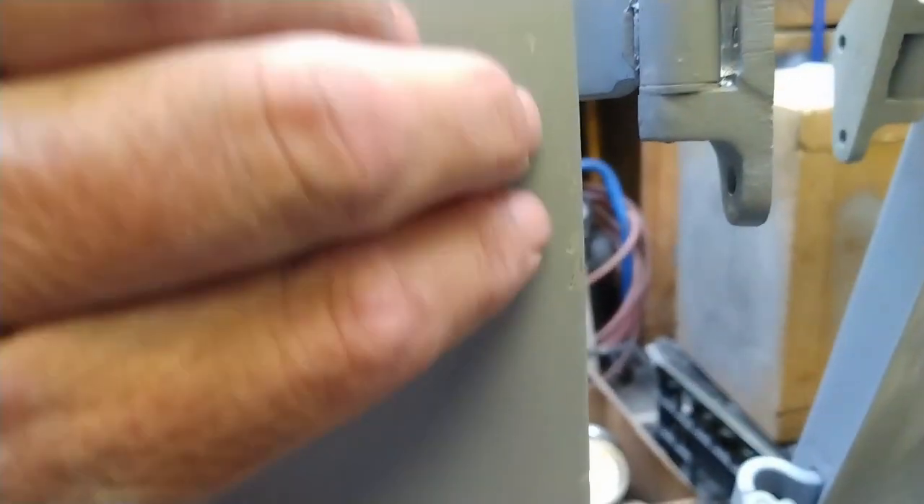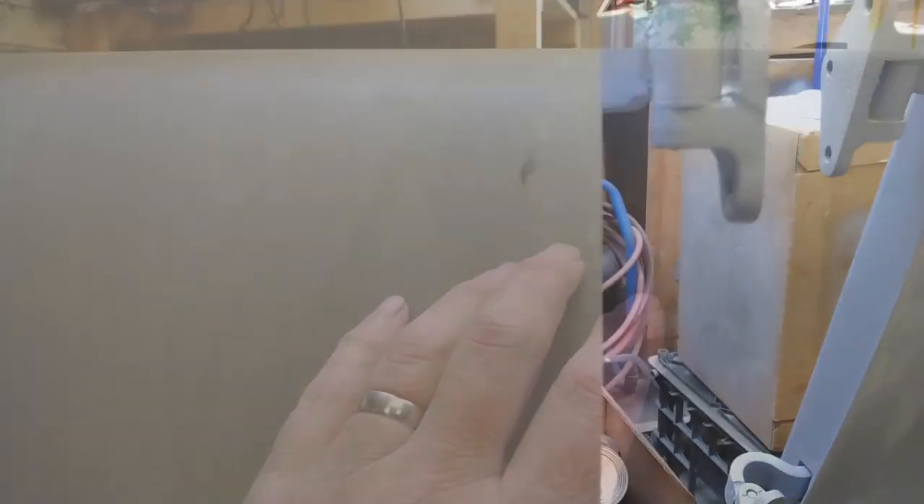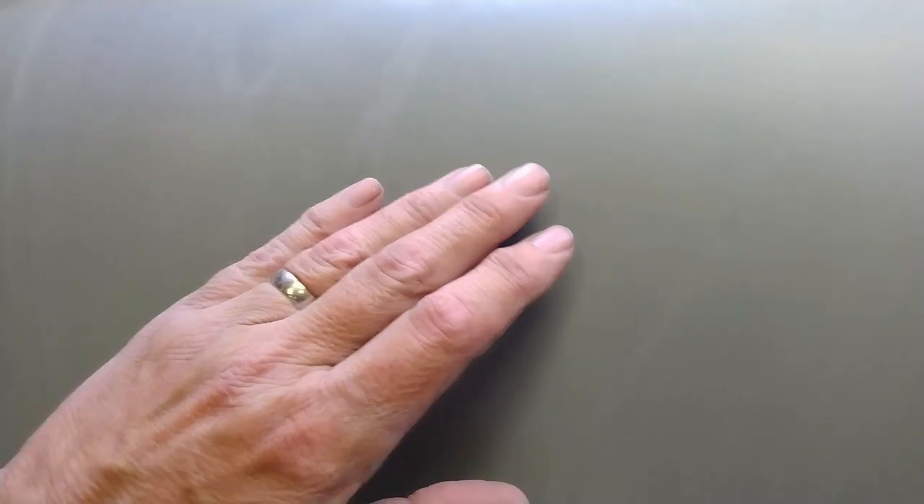Sometimes you discover damage to the door, and I remember it did fall over the other day, so I've got some repairs to do in the paint here. I'll sand that back and get a couple more shots of the high build primer on there. I've also noticed some sanding marks through here, so I'm going to sand this back further with the 320 and 400 and come back again with the wet sanding. I'll check the other door for the same thing and make the necessary repairs.